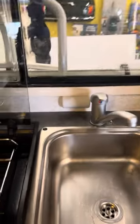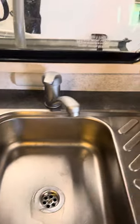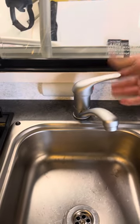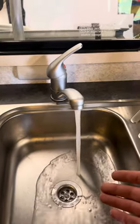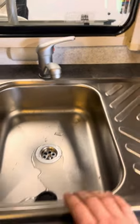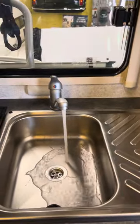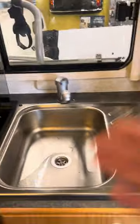All the lights under the counters here will all come to life as well. When the water pump is turned on, the first thing you're going to want to do is come over to the tap just here. Turn the tap to the right-hand side and pull the water through — that's going to be your cold side first. We've got good pressure, no air coming out; it's not coughing or spluttering. When I turn it off, the pump turns off as well — so that's absolutely perfect: good pressure, no leaks, cold side is good. If I turn this to the left now, to the hot side — brilliant — that's exactly what I wanted to see on both cold and hot.